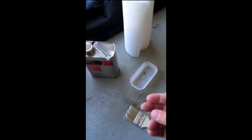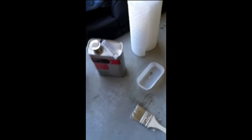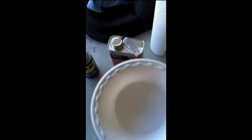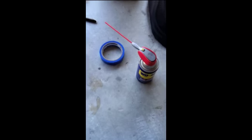And if it's still tacky, what I've done before is added just a little resin and a lot of hardener where I know it's going to cure super fast, and I'll put it back on top of a tacky layer that didn't harden like it should. It's probably not the best thing to do, but from all my fiberglassing, it's worked.